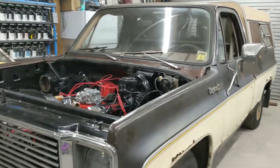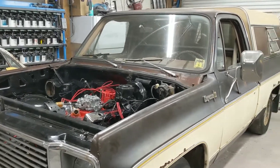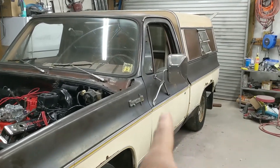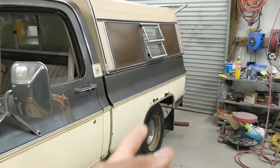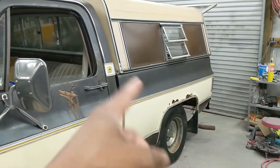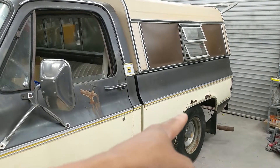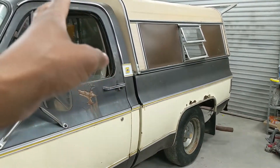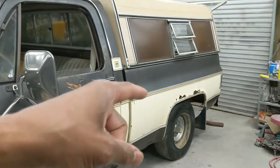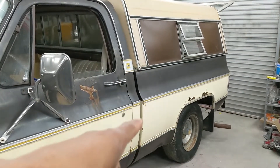All the parts are here — it's really up to your boy Thrills to make it happen. The Block said he'll be swinging by to take care of the back brakes. I'm going to pick up wheel cylinders and new shoes. The drums have been replaced and the shoes have been replaced, but one wheel cylinder locked up and the other busted, so one shoe is half the thickness of the other. We'll replace both wheel cylinders — I've got the entire hardware kit, the springs, all that — and put new shoes back there. The drums themselves look brand new.